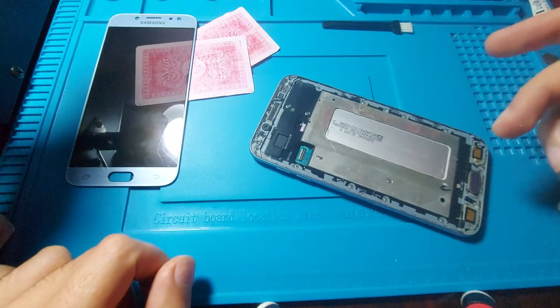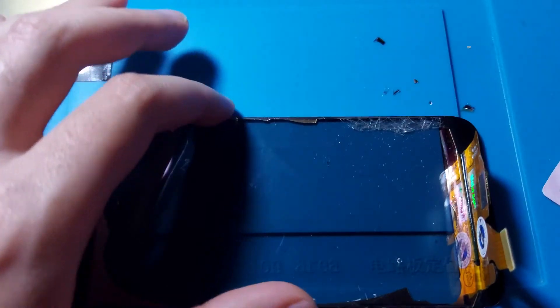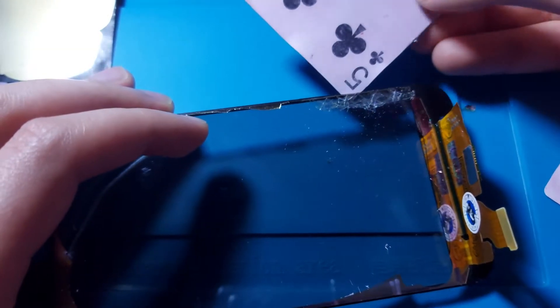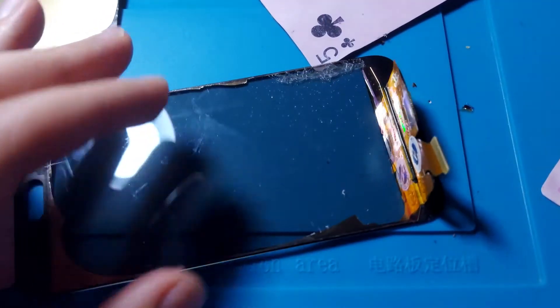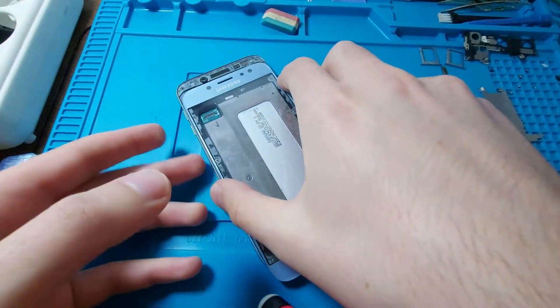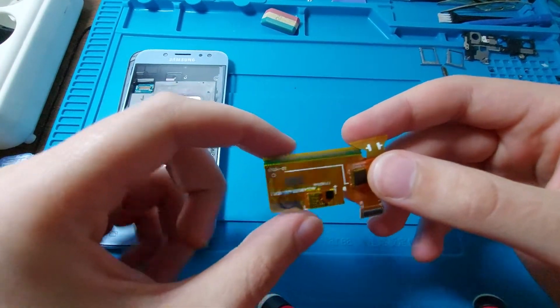I will separate the glass off camera for practice and keep it as a souvenir. From what I'm seeing it appears to be an original panel, but the layers have separated and I'm left with a polarizer film glued to the glass. You can see that with this card it gets a little bit darker when underneath. I finished separating the glass from the display — I only have the glass which I will keep, and I've kept the cable because I completely destroyed the display when removing it.